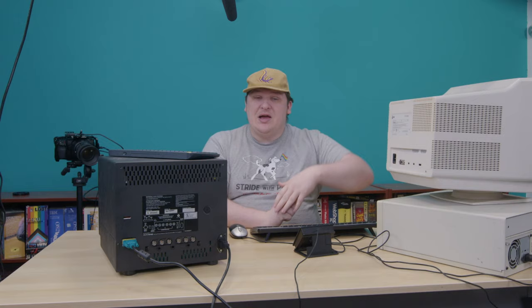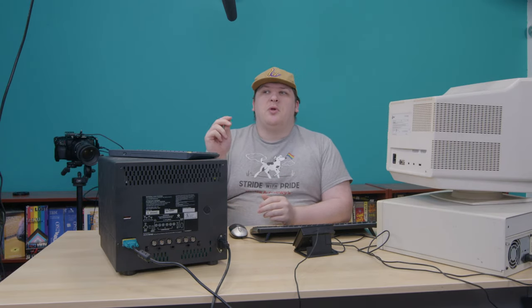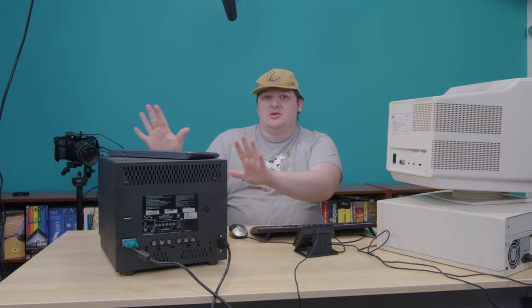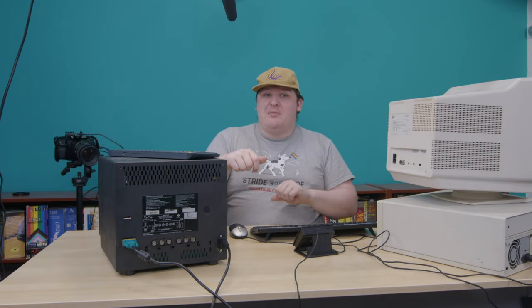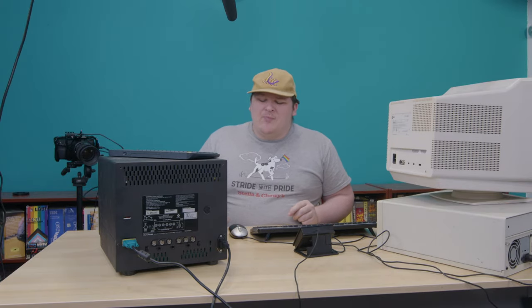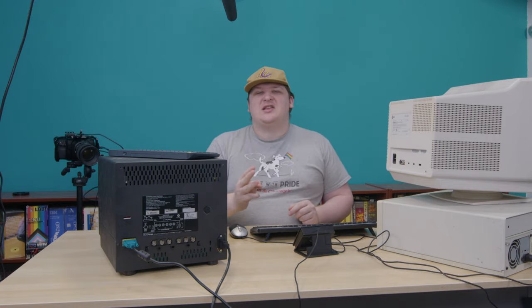between certain video modes. And then you got wild stuff like the ATI EGA Wonder, where you could plug a VGA monitor in and then tell the card to appear to the system as EGA, and it would do that, and then just convert it internally to work on that monitor. Or you could send the card VGA with an EGA monitor connected, and it would convert it the other way. Or you could plug in an MDA monitor, and it would convert CGA to MDA and all these other things. They sold it as, what was it, run any program on any monitor at any time, I think, was their tagline for it.